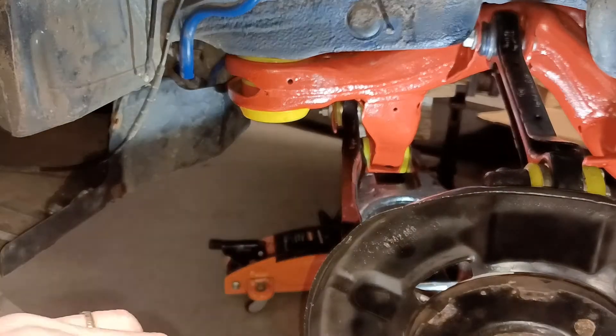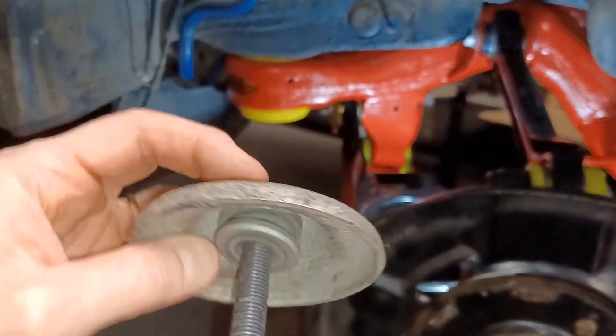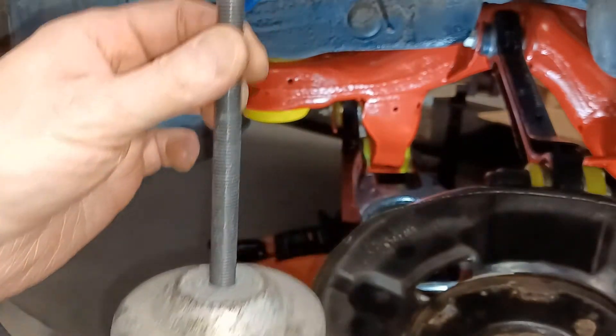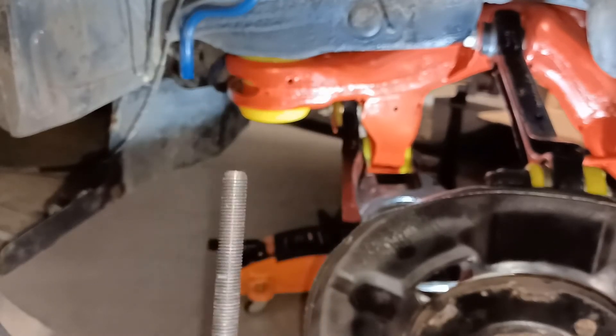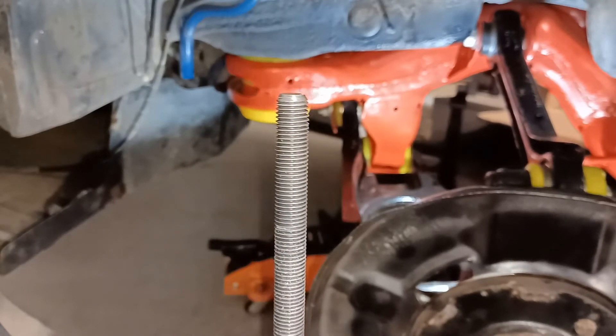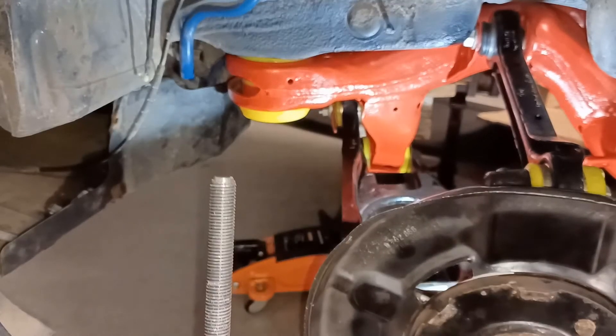So I'm going to put two washers in, put the bolt through the two, and bolt the whole lot up into the body of the car. This is all just belt and braces stuff because I'm worried about the damage that was done to the threads when I crossed the threads and got the bolts stuck in the chassis. I just want to make sure I'm using every millimetre of thread I can possibly use, and as I said earlier, I've cut more thread using a plug tap.